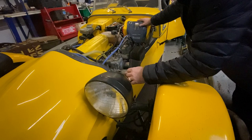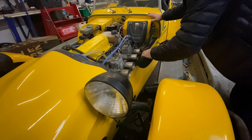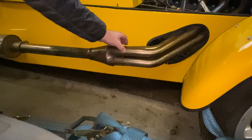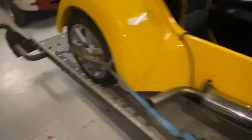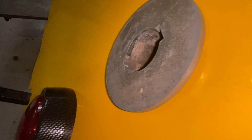These feel a bit crusty. This isn't acceptable, and that isn't acceptable either. The previous owner reported fuel exiting here. I don't like the way this clutch cable comes out of the bulkhead through the four-branch manifold. Green beam doesn't work, flashers don't work. These bolts are too long — these studs — to get the wheel trims on. Fuel cap missing. Seat belt missing. Gaiter missing.